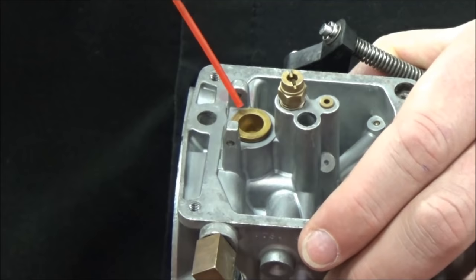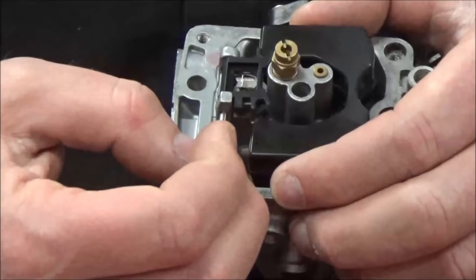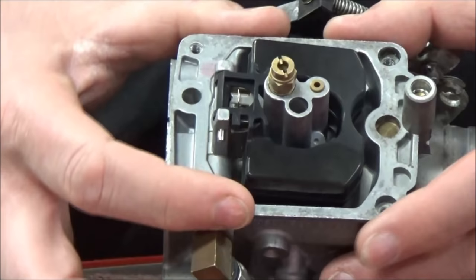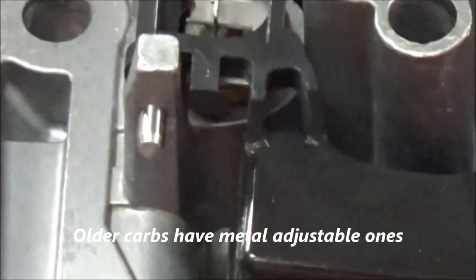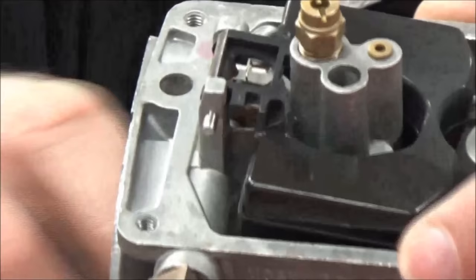Another thing I'm going to do is get it wet. I think people overlook this — there's a chance it could just stick open for a little bit and spill a little fuel. Now, since I want to show a couple things, I'm not going to fully insert the pin just yet. Also, a lot of people might not be aware of this little plastic tab right here — it limits the travel of the float to fully open. That's important because we wouldn't want the float needle to jam or stick and not be able to shut back off.